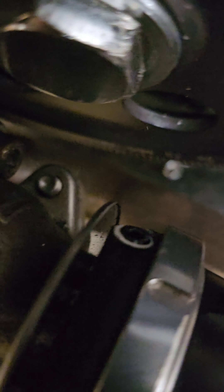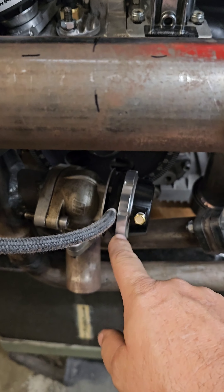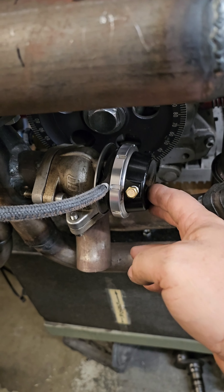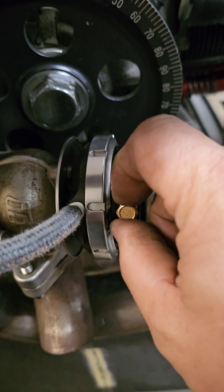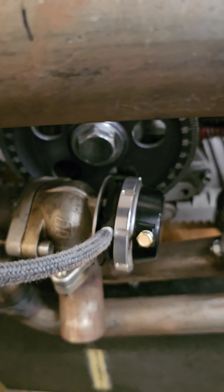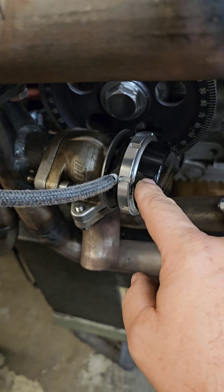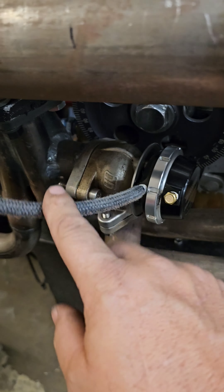Besides that, the wastegate's all plumbed and done and plugged — you can see there, I got the plug plugged in there. It's going to the low side, already set up so the low side signal can be an eight-pound spring, or eight pounds of boost. I put a filter in — this guy didn't have one, I don't know where it's at, but I just wanted to put one in. You leave the top open to atmosphere and that's what the filter is for. If I was running a boost controller I would tee off of this into the controller, out of the controller into this, and that'd give you adjustability for even more boost. For now we're just going to give it to him at eight pounds of boost.